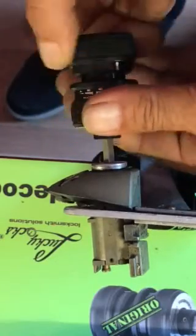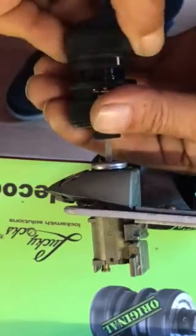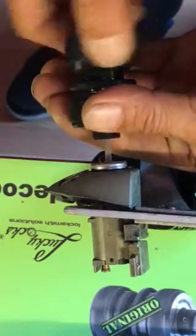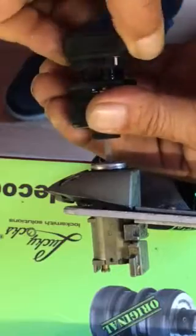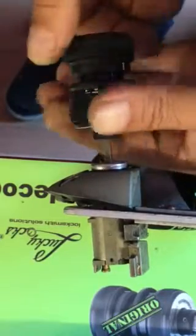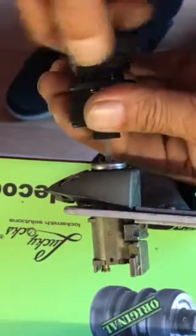If you miss the opening on the second sector, you have to increase and go to the third stop sector. If you miss also here the opening, there is nothing to do. It's absolutely normal. You have to extract the tool, reset and try again. Let's see what happened with the pins. Pull back and see the pins.